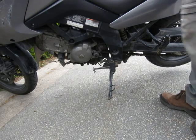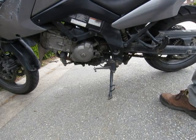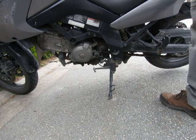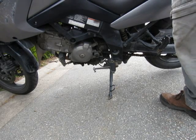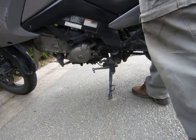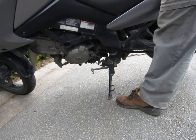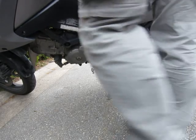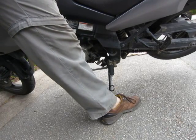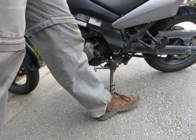So you can do maintenance if you prop something underneath the swing arm on the other side of the bike. You can see half an inch or even a quarter inch of air underneath the rear tire is plenty good for chain maintenance. Now I want to show you the upper limits of safety — the bike starts to tip over somewhere around when the rear wheel is about six or eight inches up in the air, which would be way too much and totally unnecessary for chain maintenance.